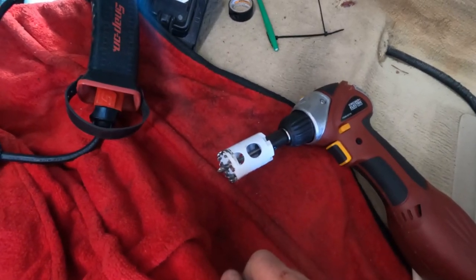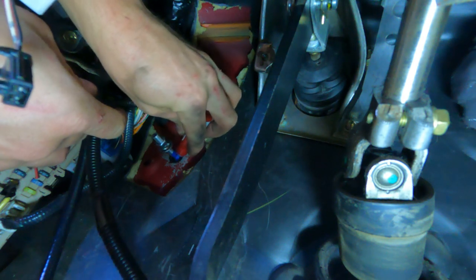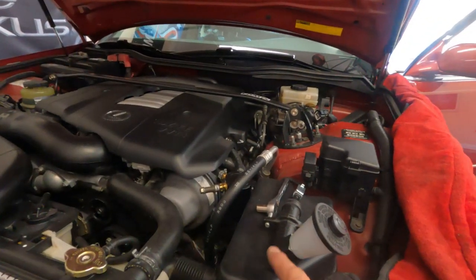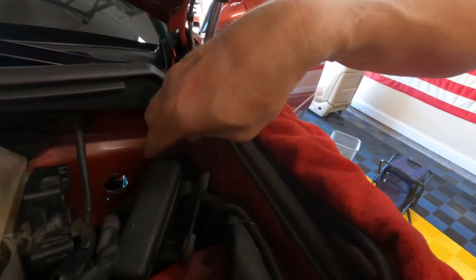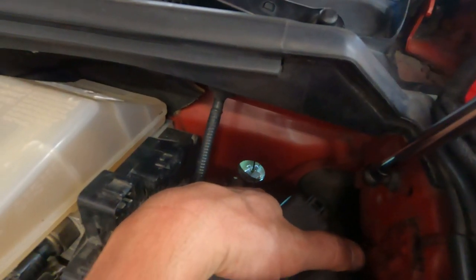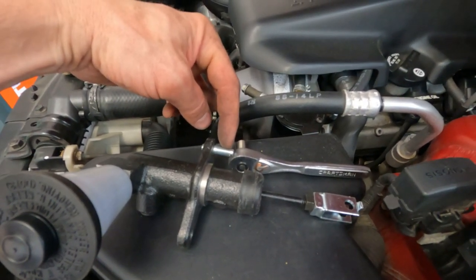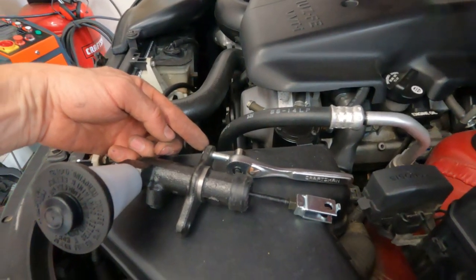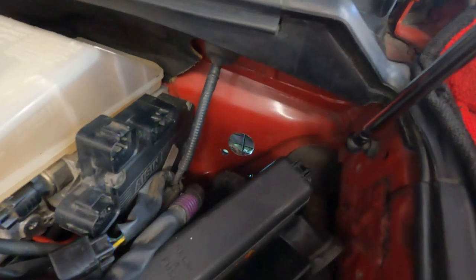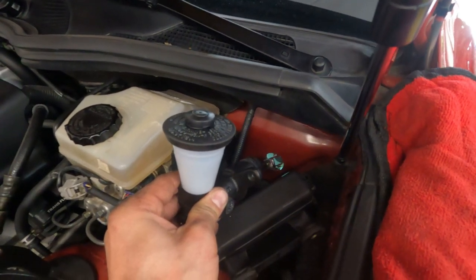I recommend thread locker on all of these connections. Let's talk about this Land Cruiser clutch master cylinder. You're going to need to undo the two 10 millimeter bolts holding the fuse box and relay box right here — that'll give you a lot more room to wiggle stuff around and push it down. The hole we previously drilled is actually perfectly sized for this stud. We're going to take this stud out of there, run the fastener through the firewall and through this, then secure it with a nut. I already test fit it and it looks great.